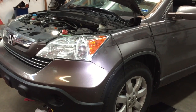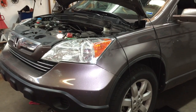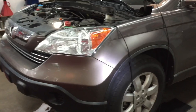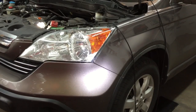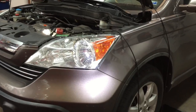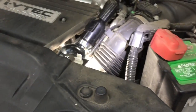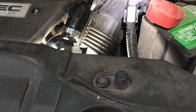This is my son's 2009 Honda CR-V automatic transmission. I'm going to show you how to change the transmission fluid — it's real easy and I've got a few tips that might make things easier. As far as I know, Honda is the only car that you check the transmission fluid with the engine off. Most other cars you check it with it running, so keep that in mind. First, what I like to do is check the transmission fluid level before you even start.